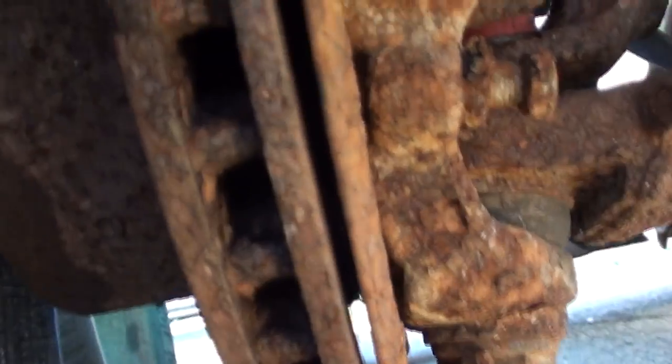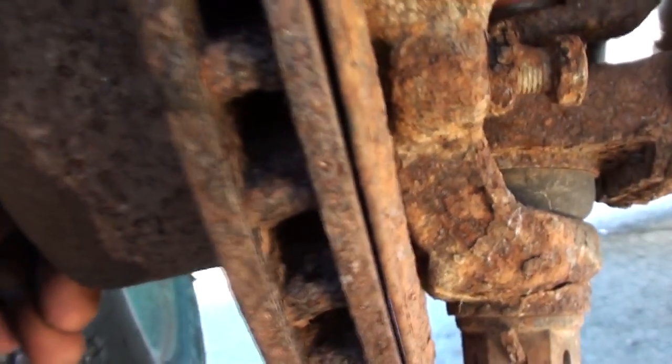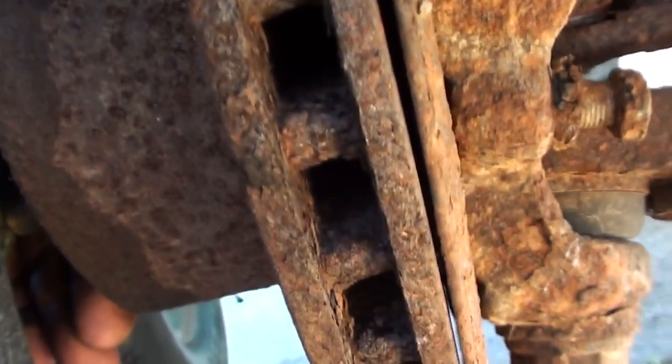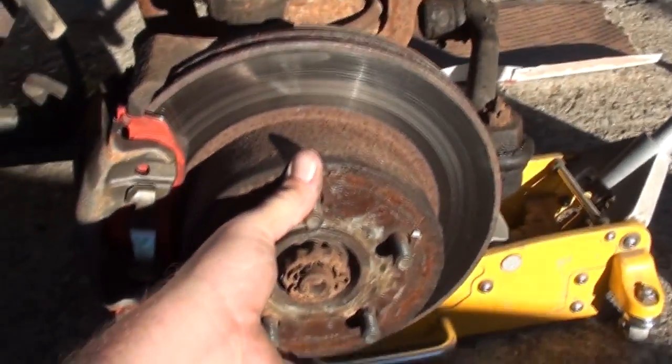But anyways, there's this. Now see, this side isn't touching unless the rotor's pushed. It's touching almost. You can kind of see it there. So I'm going to clearance that just a little bit more, because when I'm driving and I can hear scratching, that drives me nuts. I don't like that. So anyways, that's all I'm doing. No big deal.